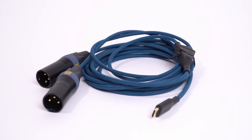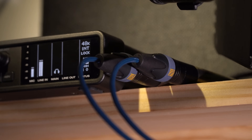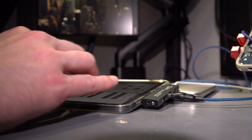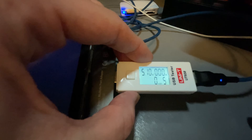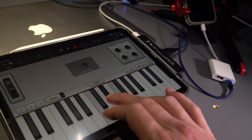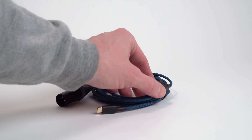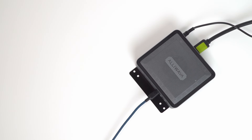In use for the last few months, this Sound Wire has been absolutely flawless. I've had it on my desk every single day, using it primarily to connect my iPad to my audio interface's line input — either plugged directly into the iPad or through a dock. It draws very minimal power; my system says it's drawing 100 milliamps, and my little USB-C current meter doesn't even register it. My iPad charger has no problem keeping the iPad at 100% while using this all day long, since the iPad is what supplies the power to the Sound Wire.